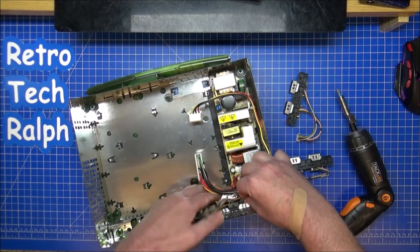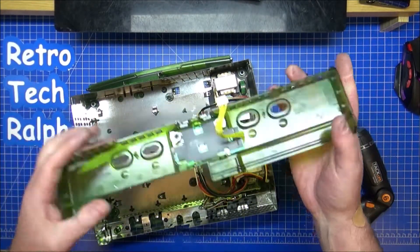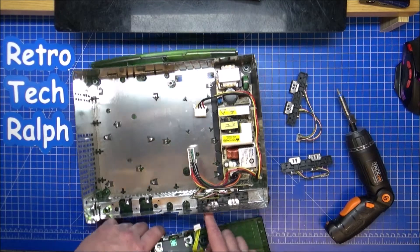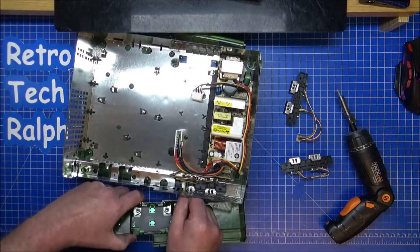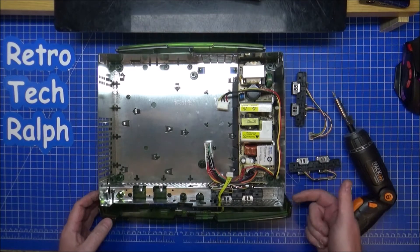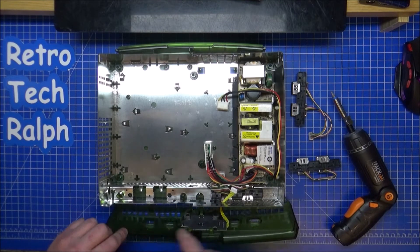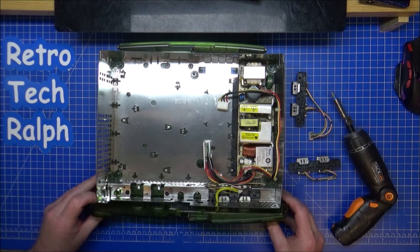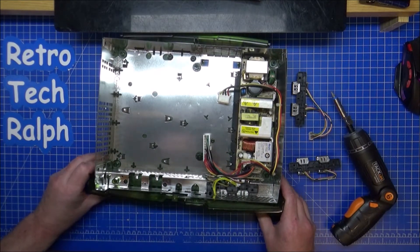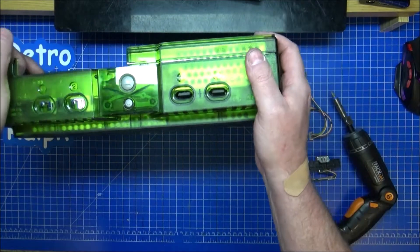I'm going to do this awkwardly. Actually what I need to do is put this in place. That goes in — can't go in that way because there's an oval here, it won't fit. So you're putting it on the side, throw it through, and then we're in. Push through. I'd actually recommend, if you're taking these to pieces, it clips on the side here and the side here, as well as the three tabs here. You want to prise off this side as best you can, and then push down on or pull up on these tabs. Put it back in place — it should just snap back into place, but it always feels to me like it's about to break. So be careful.